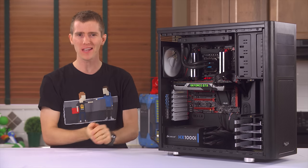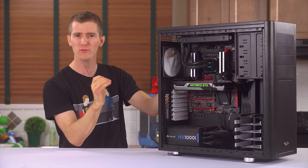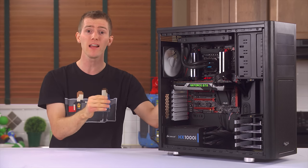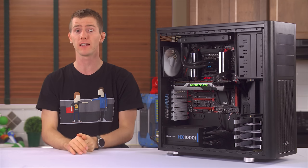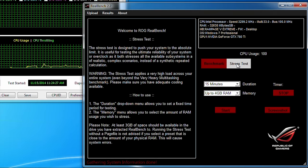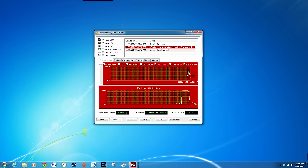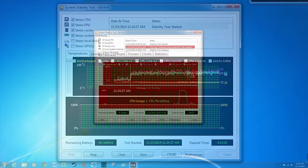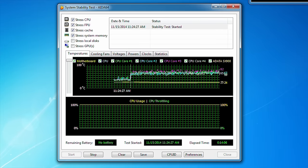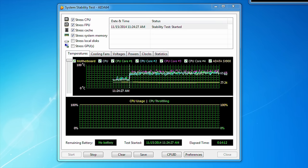Make sure your benchmark is a safe one. Recent versions of Prime95 can cause your CPU to pull so much power in an overclocked, overvolted environment that you're sure to do long-term damage if you use it extensively. I'm partial to AIDA64, but ASUS's own ROG RealBench is a solid choice as well, and it's free. If the test fails in the first 10 minutes or so, go back to the UEFI BIOS and try a lower multiplier, or — as long as CPU load temps are within your comfort zone (80°C max for this guide) — slowly turn up CPU voltage to see if that helps, then reboot and rerun.